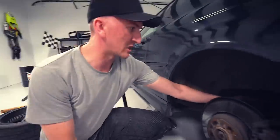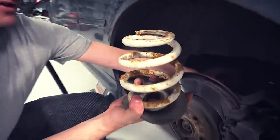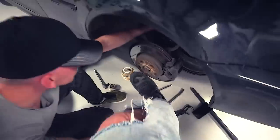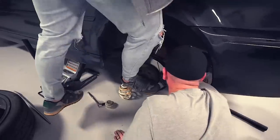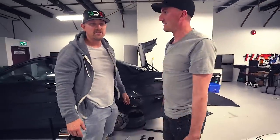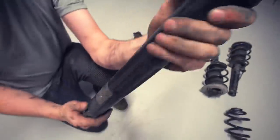We're starting with the back - it's the easiest. Come close, you can see the adjustment for the springs in the rear and the aftermarket spring. We need to remove the bottom collar from the coilover - you can see where the spring sits. We don't have the factory rubber boot so we're going to have to go metal-on-metal for a bit and replace it later - it's gonna be noisy. We've got to get the spring back in there. One of the only times 240 pounds came in handy!